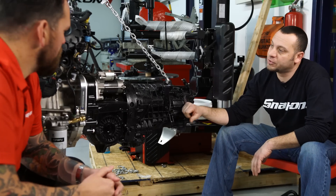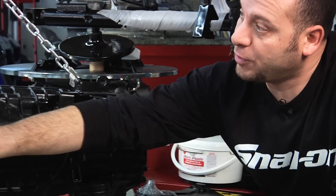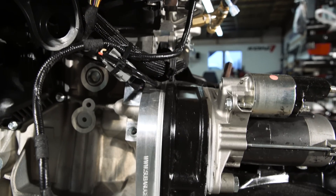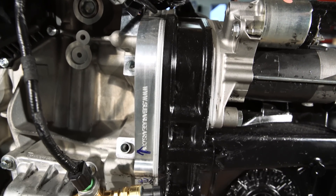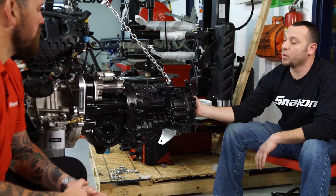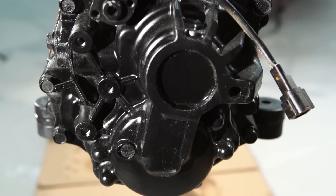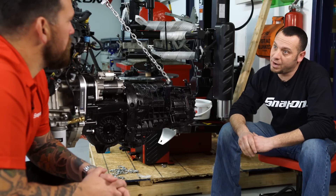We're still going to keep the 6-speed transaxle. We had an adapter made, so it'll actually bolt up to the original 6-speed that comes out of the SUV if you get a donor. Since this transmission is normally in the front of a car with a diff, we give it a 2-wheel drive adapter — you take the diff off, cap that, and make it front engine transaxle, rear-wheel drive.